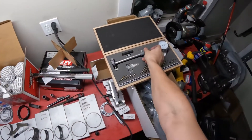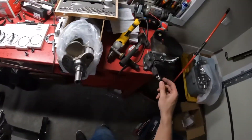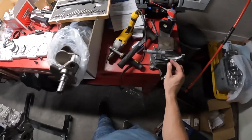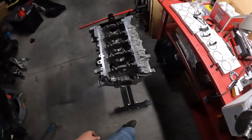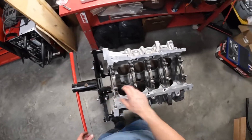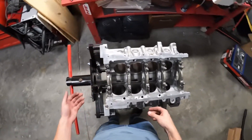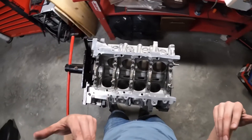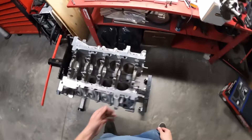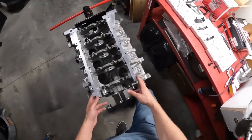This is still a tedious process. I'm going to measure each one of these main journals separately. If everything is perfect, this measurement will slide across each one and be perfect. If it's not, I'll have to remove and re-zero my gauge. I need to start from one end and work across, pulling the caps off and reinstalling as I go. We already know this one's good — I did this one first to make it an easy video for you guys. That's how you check your main clearances for your main bearings.